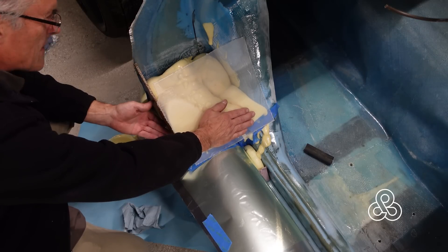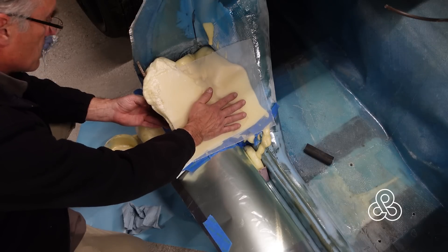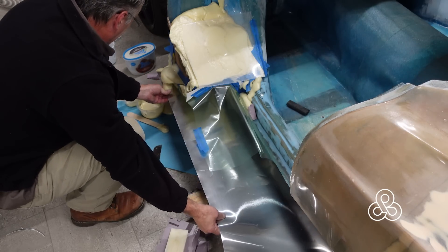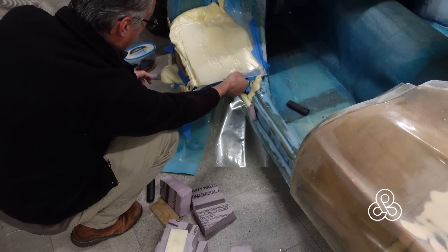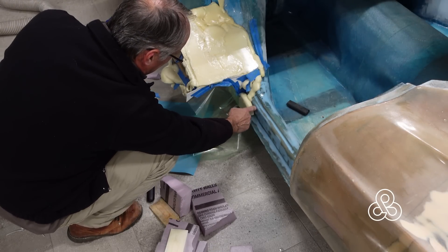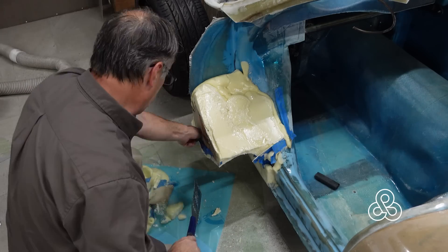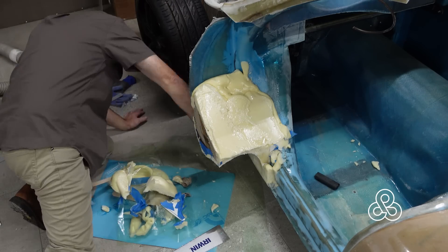You'll also see the bottom side of this form is a piece of aluminum sheet metal that I've bent into a curve that actually creates an aerodynamic duct flowing from the wheel well out underneath the door. Once our foam is expanded, we're going to start taking all those forms out. Here comes that aluminum piece — you'll see later on as we get this thing trimmed up the nice curve that was created for that aerodynamic duct. We're just going to strip off all our forms. Some of this foam just kind of snuck out through some cracks, so we'll break that out, get all the form material out of the way, and start shaping. Remember also that each time I do something here, I'm doing the same thing on the opposite side of the car, trying to keep everything exact and symmetrical.